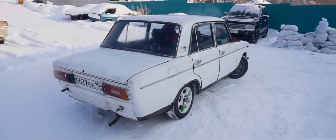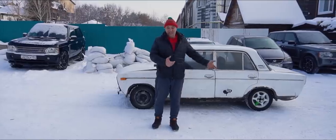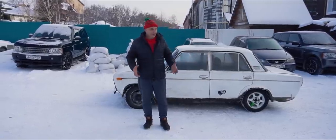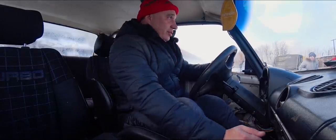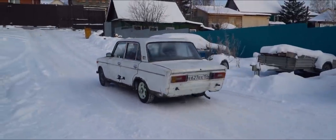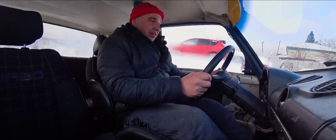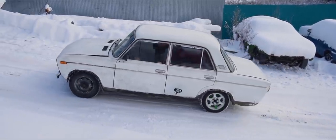This car is also running a welded diff, meaning that the two wheels will be rotating at the same exact speed. We simply don't have any cars on hand where the diff isn't welded. Admittedly, you could say that we're cheating by using a welded differential, but what we really need to do is try this out and see what happens. We'll begin without any load in the back at all, but on some good rubber. I'll drive a bit closer to the incline, then make a slow, smooth attempt at setting off and see if we have any luck. Carefully feathering the gas pedal.